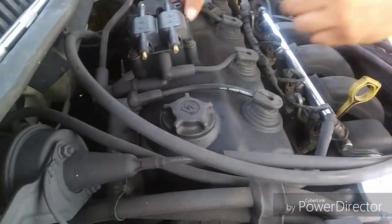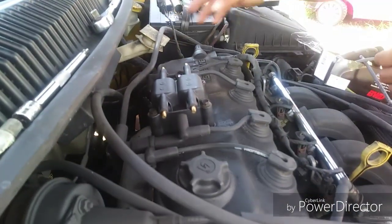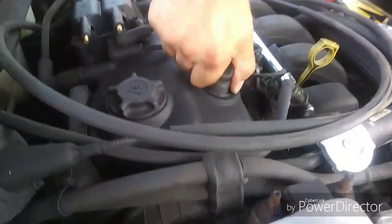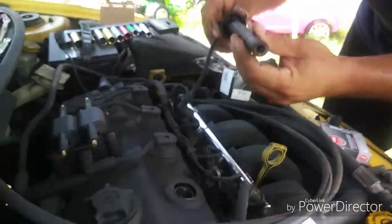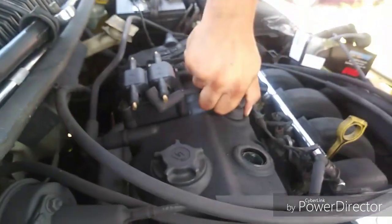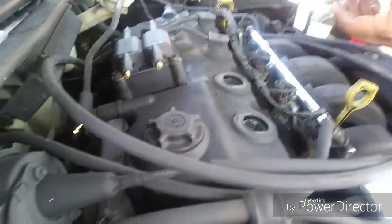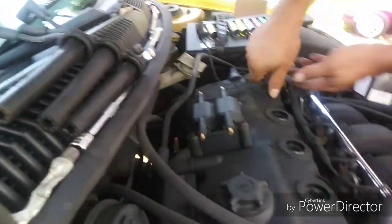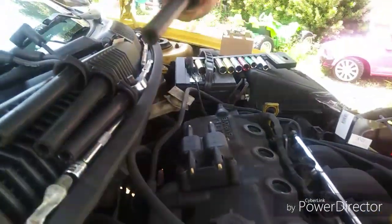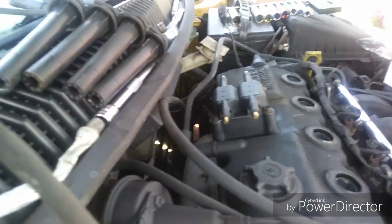You can see here these are your spark plug wires. There's only four cylinders so there's only four wires. That one came out pretty easy and didn't look too bad. You might want to save all your old parts in case you need them. I've got them laid out one, two, three, and four so I remember where they go.